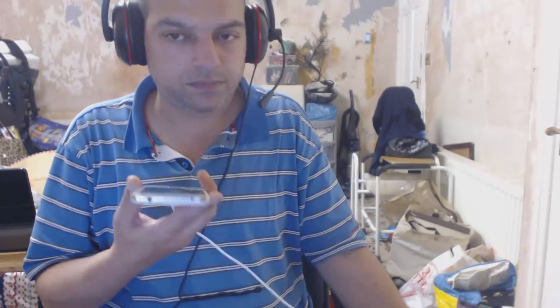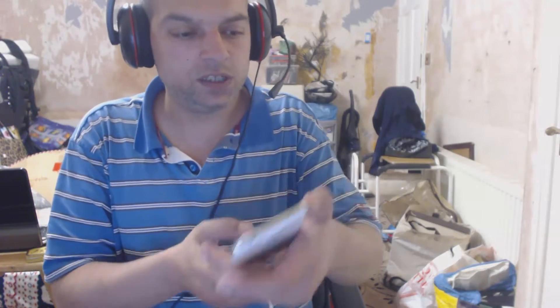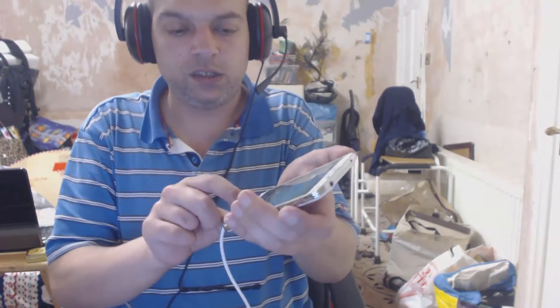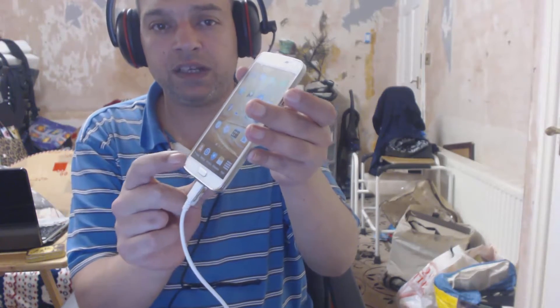You want to start with your phone, your S5. What you need to do is volume up, then home and power — volume up, home and power. Turn your phone off and then hold those three buttons. And what you get is this kind of special screen. When you hold those three, it goes into a special screen.